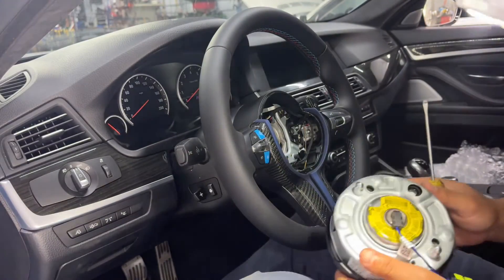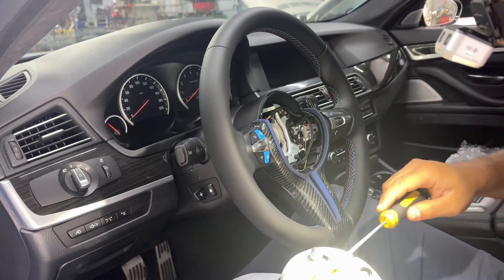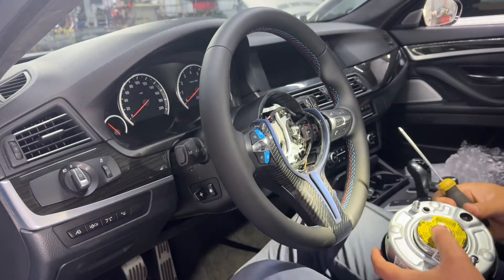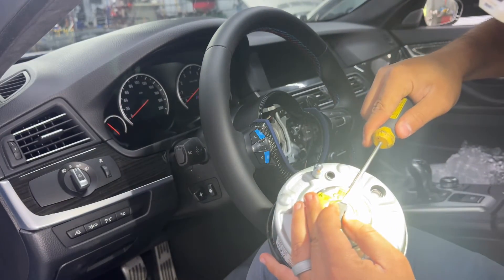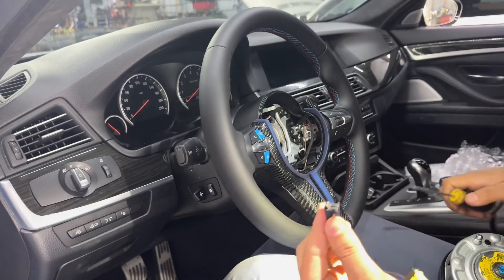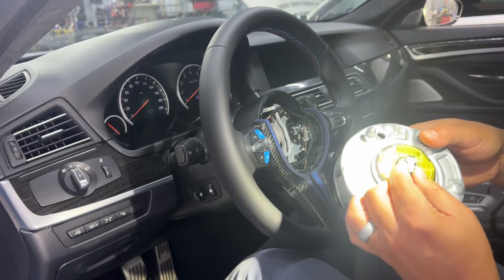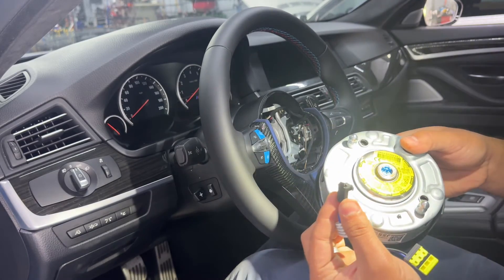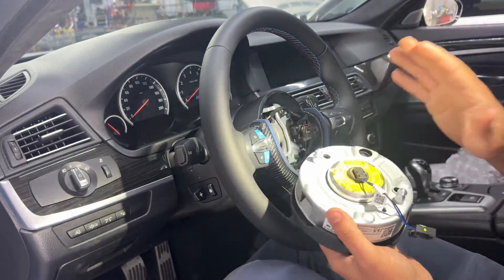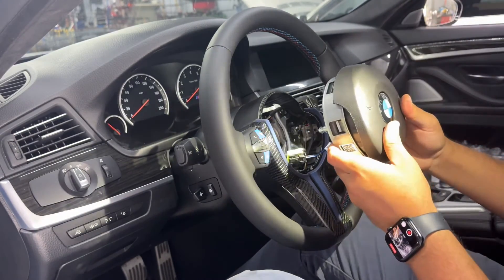With the steering airbag off, the only way to remove this connector is with a flathead. It has two tabs on each side that hook up inside the pigtail connector. I'm going to put my flathead behind here and pull slowly — there we go. That's how the connector comes off. These are the two tabs I was talking about — there's really no space to push them while inserted, so using the flathead behind the connector is the only practical method. To reinstall, connect it, adjust, push it in, and that's it.